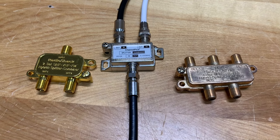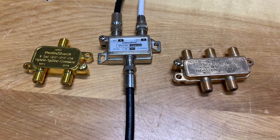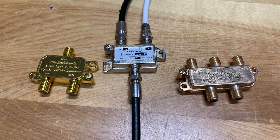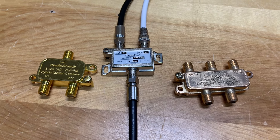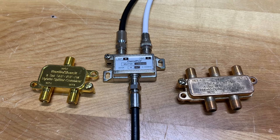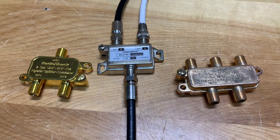All your over-the-air antenna channels will come in along with your modulated channel. If you want to send this to more than one TV, you can connect this cable to either a splitter or a distribution amplifier and send both signals to all the TVs in your house. That will also allow you to watch your own personal content on your modulated channel — essentially what you're setting up here is a closed-circuit private cable system that's only viewable on your TVs.